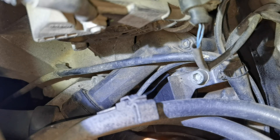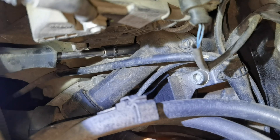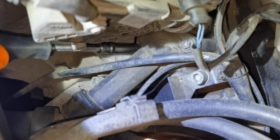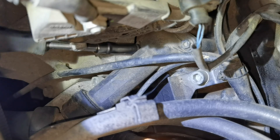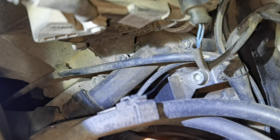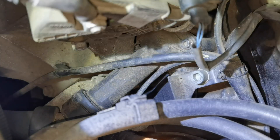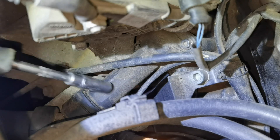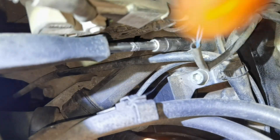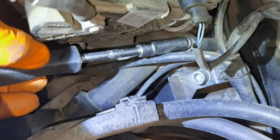To reach the thermostat on this car you have to remove this plastic thermostat housing first. Remove the two screws with a 10mm socket which are securing it to the engine. After that pull it out and right underneath will be the thermostat. The thermostat will also have one o-ring or rubber gasket mounted over it — make sure not to lose it. I recommend replacing both the gasket and the thermostat with brand new ones so the job is done properly with no future problems.